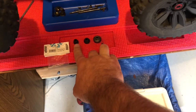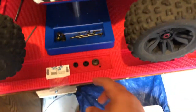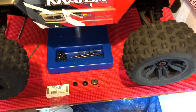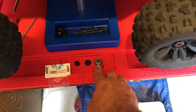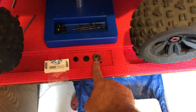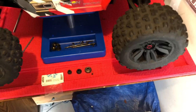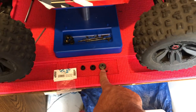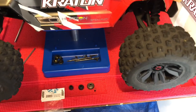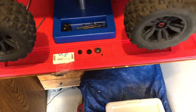The next thing is to give you a little understanding of how these work. The smaller the size of the gear, the quicker the acceleration. The larger the size of the gear, the higher the top-end speed. You'll notice the size difference on this is much bigger, so you don't necessarily lose a ton of acceleration — it's almost hard to even detect it. But with the jump from 13 to 20, you're going to get a massive increase in top-end speed. In general terms, getting a gear with more teeth means a faster vehicle, and you probably won't even be able to tell the difference in acceleration, but you will definitely notice an improvement in top-end speed.